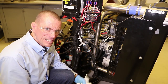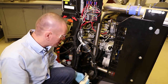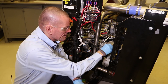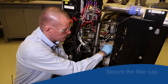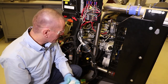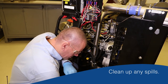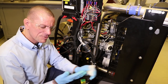Do be careful because there is a little bit of a delay as the oil runs down to the bottom of the sump, especially if the engine's really cold - so don't rush is probably the best advice. When you're happy with the oil level being correct, make sure the filler cap is securely refitted and tight - just finger tight on this particular engine is adequate. Do one last final check, and clean up any spills - I did drop a little drip, so you saw me wiping that up. You'll also notice I'm wearing gloves - we don't want to get oil on our fingers.